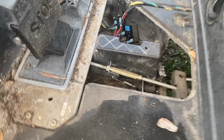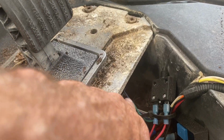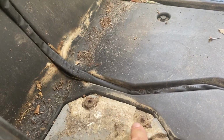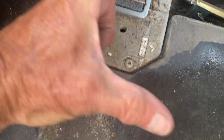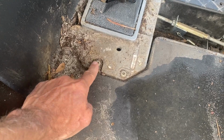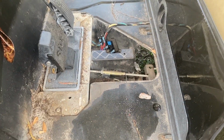And we're gonna do a little bit of cleaning, get this mess out of the way, but the MCOR is plugged in right there. So next step, I need to take these screws out. These 2 go into plastic. These 2 over here are gonna be a little tougher. They're probably about that long, and they actually go into the aluminum frame. So we need to take those 4 out, and it should lay aside. And hey guys, I didn't mention at the beginning, but be sure to cut your run tow switch off.